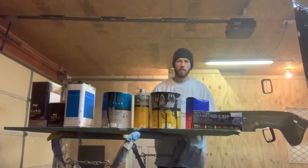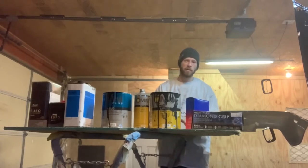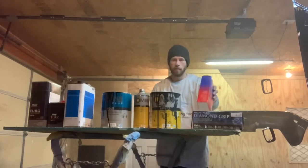A little bit of a recap: we started by cleaning everything out. We used our water-alcohol mixture to wipe the dust up first — that's not going to clean wax and grease as well, but it removes dust particles very effectively. Get your panel really clean to start, then come back and use the wax and grease remover, DX 330. After wiping with the wax and grease remover, definitely use tack rags.